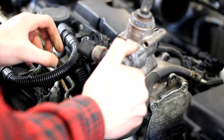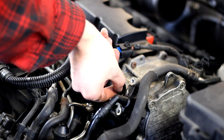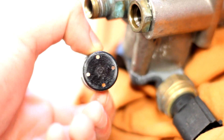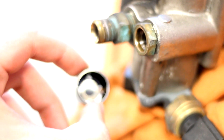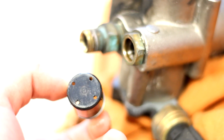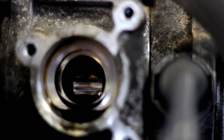Here is our fuel pump — it's leaking a lot of fuel, but that's to be expected. Go ahead and pull out your cam follower if it didn't come out with the pump. With the follower out, you'll want to inspect it — look on the inside and the face to see how the wear is. Mine is actually really not worn; I know it was replaced around 10,000 miles ago but I still wanted to replace it just to be sure. If the follower is worn through or has deep gouges, you'll want to replace it. You'll also want to inspect your high pressure fuel pump — mine has signs of wear because it wore through before and the intake cam was replaced. Finally, take a look at the intake cam itself. Mine is not worn; there are some tiny scratches where the follower rides but nothing major, and that's basically what you want to look for.